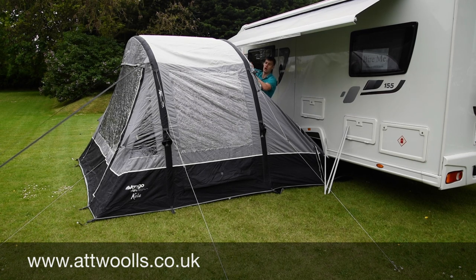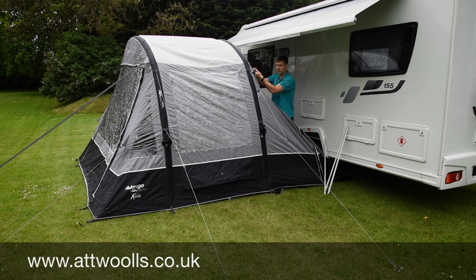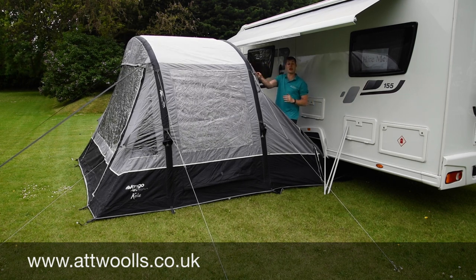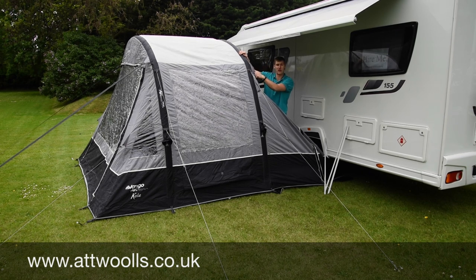You can neatly tidy it away — there are toggle points along the canopy, another one here, another one on top, so you can make it really nice and tidy. Most driveway awnings also have additional guide ropes or storm straps to give it tension. This one has a storm strap that tensions and pulls it out, allowing it to be free-standing. Without that, any wind from this direction is just going to push and buckle it across. Use those when you leave the vehicle.